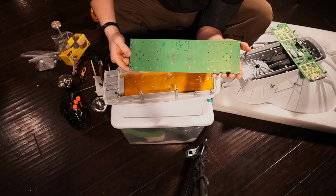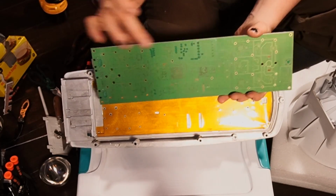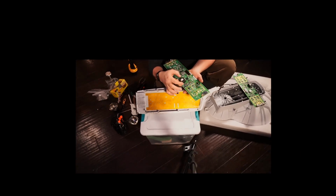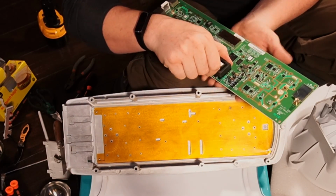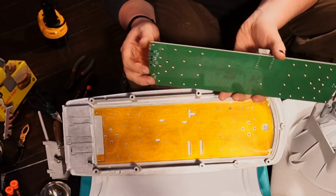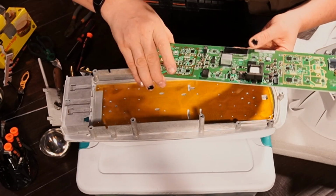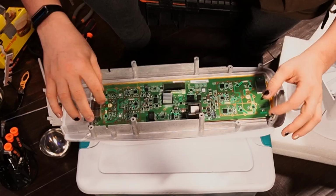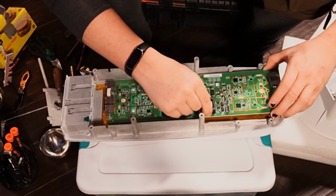Now if we flip it over here, you'll see where things marry up. If we look here, you'll see that there's a couple of knurled out little spots for the transformer pins, because you can see now how I was telling you about how strong the transformer is. This upper magnetic ring has epoxy injection on the top and bottom of the transformer to anchor it. So though I'm not saying grab that and yank on it, it's actually fairly well secured to the board, so that's a very strong anchor point that you can draw from, as are the ports to a degree. Again, I'm not saying grab things and yank on them, I'm saying that this is firm, this is firm. So if you're in here like I was showing you where the board is in place, and you need to get it out, that's where I grabbed onto here. And I very carefully worked with it until I got it out, and then got the bottom pins out, and I was able to lift it free.